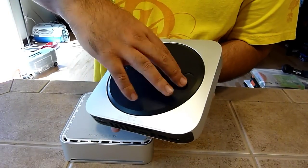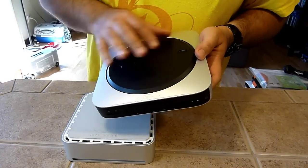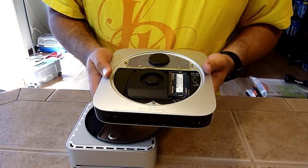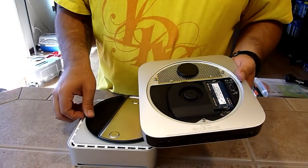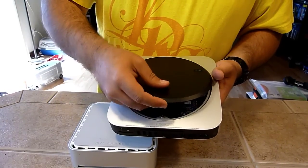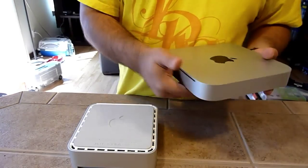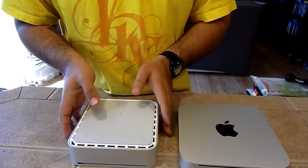But the new one, as you can see here, you just put your fingers in these two slots, turn it — let's use some thumbs, those are stronger — turn it, and it just pulls right off. You can get right at your RAM and do a RAM upgrade if you need to. And if you're more adventurous, you can do a little more in there. But at least for RAM upgrades, it's very simple. There it is locked — that's how easy that was. This would have taken about ten times longer, if not more, to get in without breaking it.